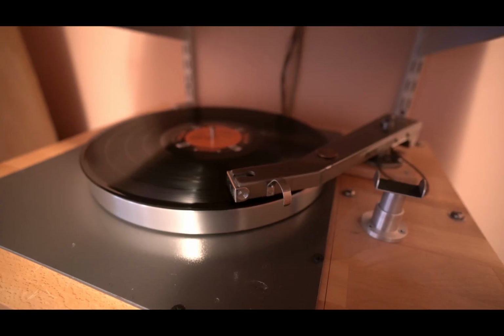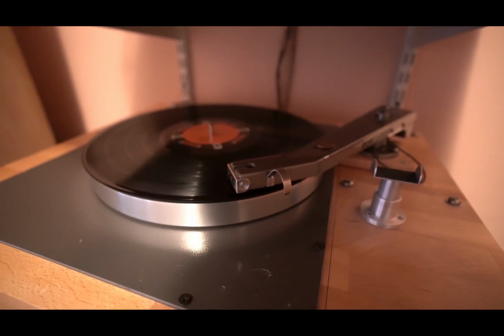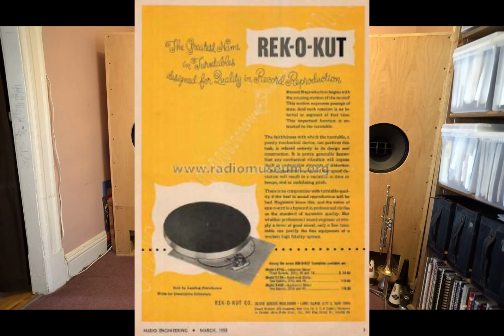Pretty much the whole setup here I got into through this Japanese guy who's well known in Japan, named Sakuma-san, who has a little bit of a cult following in the Japanese philosophy of audio. And also this cartridge, which is a Denon 103R, an MC moving coil cartridge, which has been in production for many decades, and probably not spectacular in any one aspect, but it does everything well. It's not so much about this little aspect or that one, but the overall thing is a nice balanced presentation.